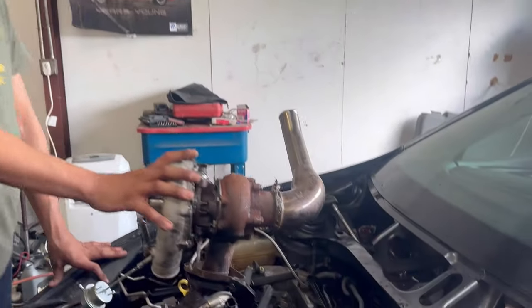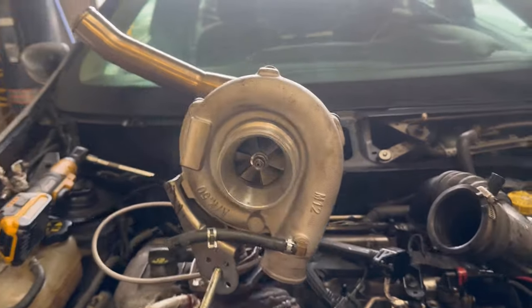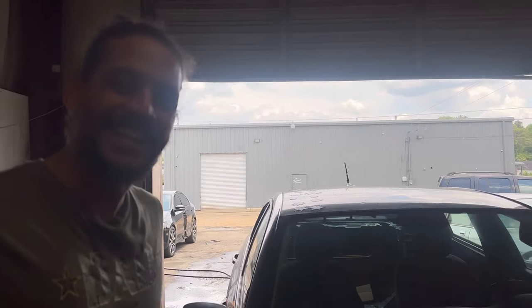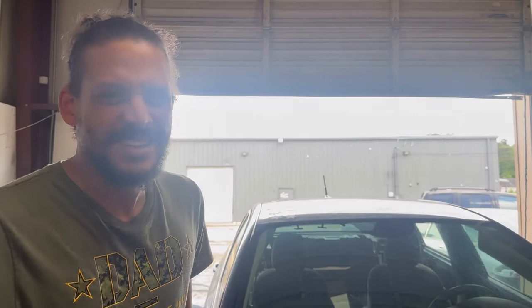I gotcha. Last time we filmed, my cousin gave me a smaller turbo, which worked out great for this application, by the way. But since then, I've burnt it up. Don't ask. I got a little too excited and didn't hook up the feed line, and I thought I could manually feed it some oil, kind of test drive stuff. Don't do that at home.